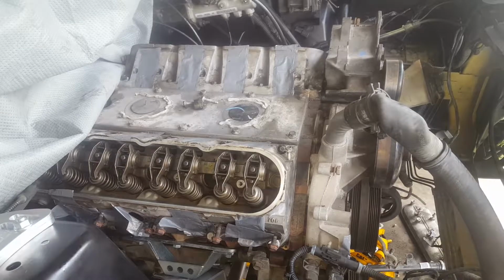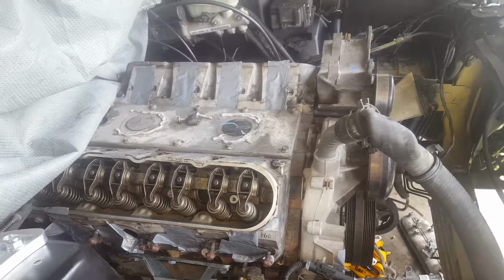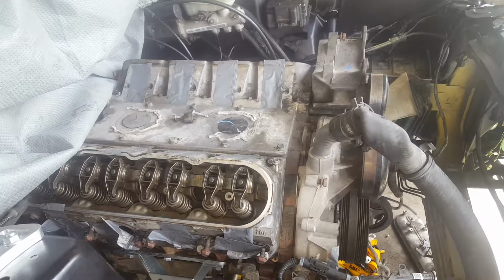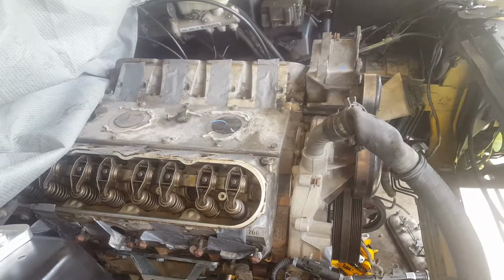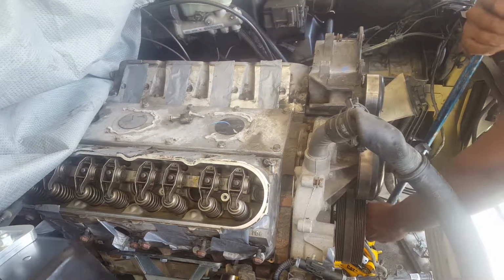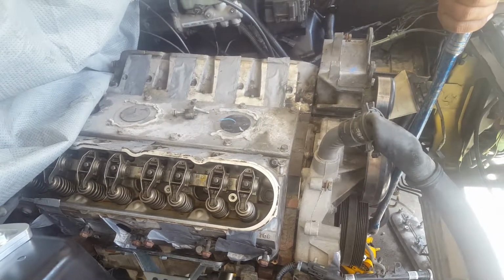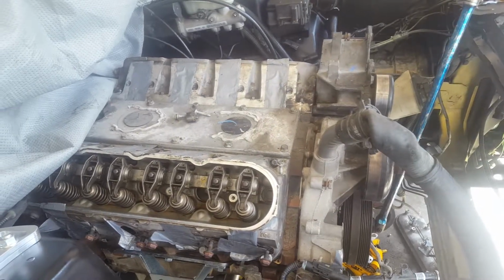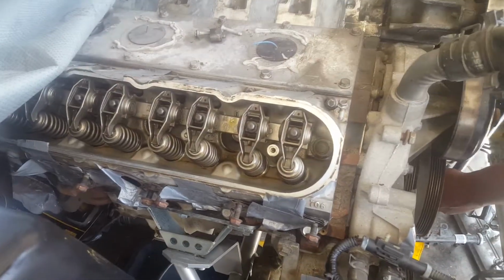Okay guys, we're back, and as you can see, both of the cylinder heads are now on. And I torqued it down to 25 foot-pounds for the rocker arms on both sides. So now the next part, according to the GM manual, this part I thought I should probably do the right way, is you have to rotate the crank just to make sure they are properly torqued down. Maybe there's some weird resistance it's causing. But anyways, I got a breaker bar here with a 24 mil, and it's attached to the crank pulley. Now I'm just going to rotate it. It says 360 degrees.